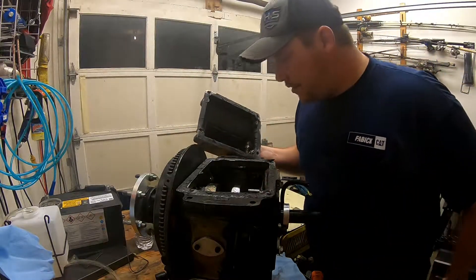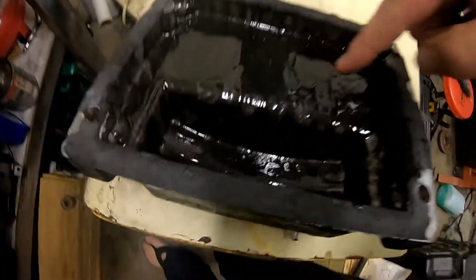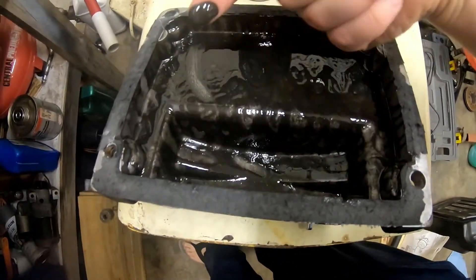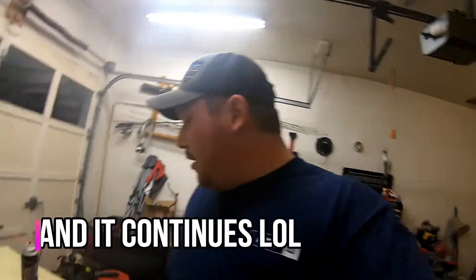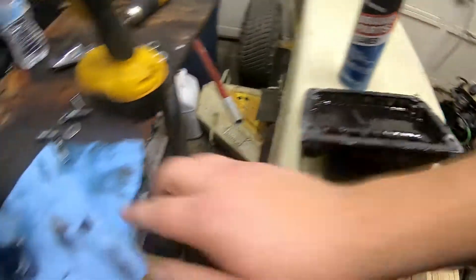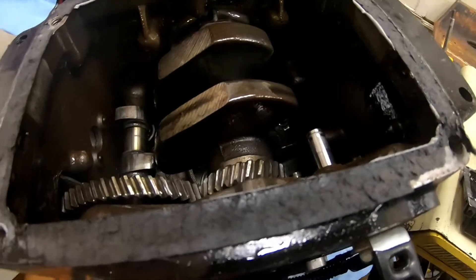Look at all that crap — it's pretty nasty and smells pretty bad too. I don't think it has any metal in it; I don't see any shiny stuff, but it's got some goo still in it. This motor — I think it was the year before — I actually starved it on oil because when I switched to a billet rod the dipper wasn't as long as the factory one. It sent crap throughout it — all the bearing material off the first one. So that's probably residual. I tried to clean it up as good as I could last time but it's still pretty nasty. No metal in it though, so that's a really good sign. Nothing on the magnet drain plug either.